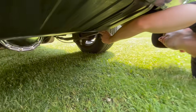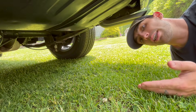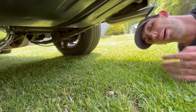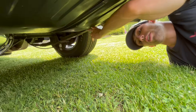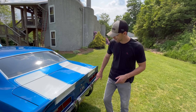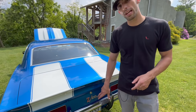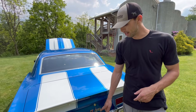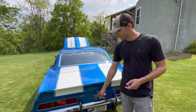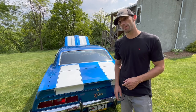This car has five leaf springs. There is one known Z28 Camaro documented to have five leaf springs, but most — if not all — came with four from the factory, so these aren't correct, but no harm done. Also, a lot of people think the emblem holes drilled into the tail pan of a Camaro are different depending on the model — SS, Z28, or the blue bow tie logo — but the holes in the rear tail pan are the same for every Camaro.